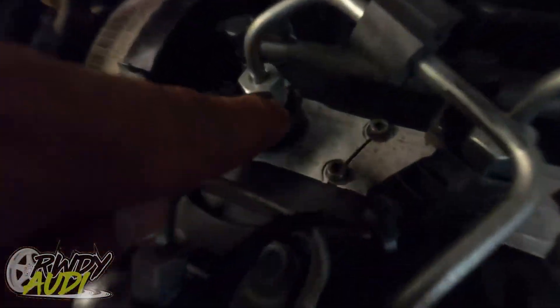There's four different ones, one for each injector. In some cases, let's say you got a junkyard engine — you're going to have to get down inside your engine and look for the code. It's going to be on every single injector, and you got to write this down so you can program VCDS with it.